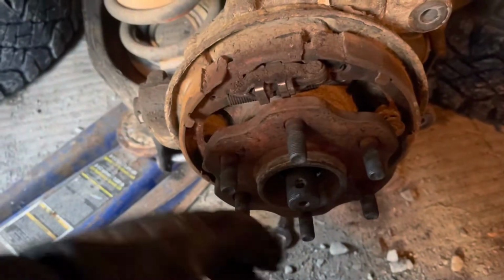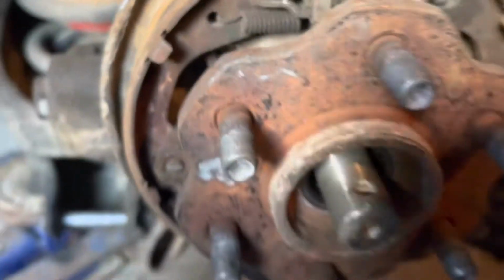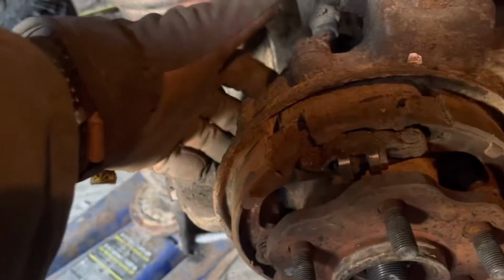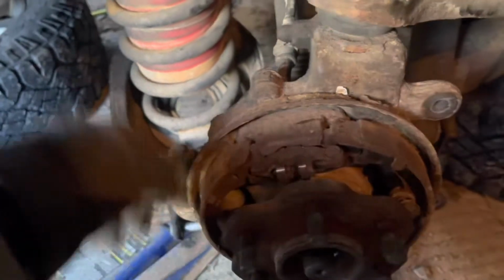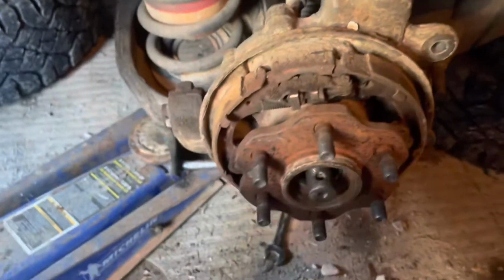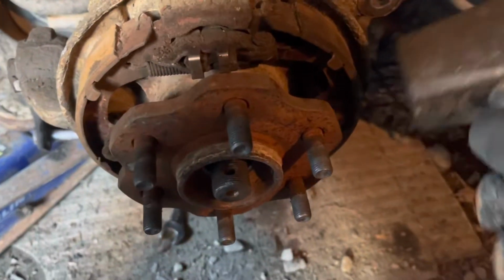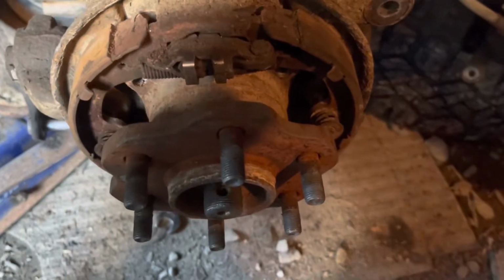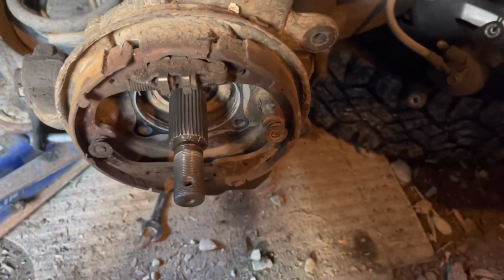So we're going to take the wheel hub off. It's 4 bolts. You can see the hole right there, and there's 2 on the bottom. Come in from the back. I found it easier to push the axle back a little bit. Put a socket on here. They're all out. These have been off fairly recently for a different repair, so probably in my case, a couple little taps, yep, and off they come, which is ideal.